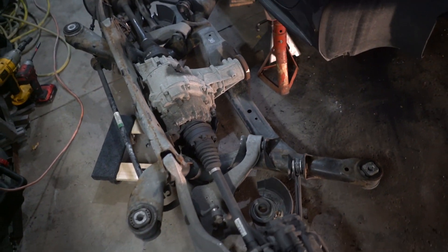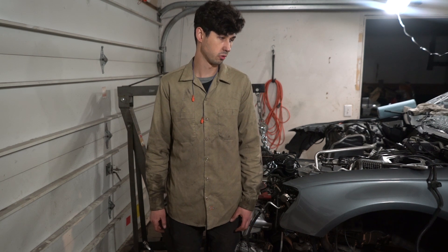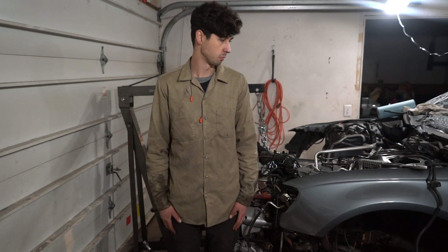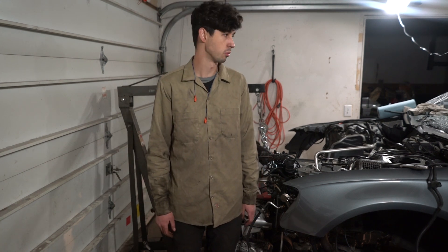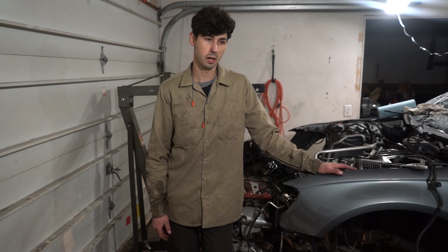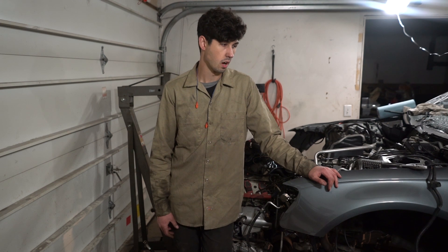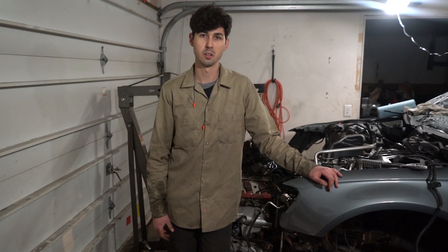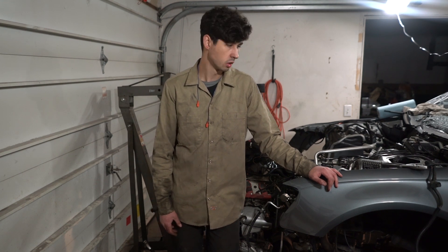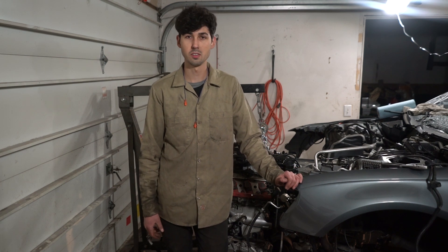As usual with these projects, we've completely run out of space already, so we're moving more stuff into the Avant just to clear out the other bay. That's going to wrap it up for tonight. We got the subframe out — actually pretty easy to do, although it's really heavy. We've got the engine out, seats into the Avant, and most of the interior stripped out of the S4. Next we're going to keep stripping out the final details: the pedal box, the shifter mechanism, and wiring for the sports differential on the rear subframe. Then we'll be working on putting the final interior pieces like door panels and back seats into the Avant to clear space. If you enjoy what we're doing, follow along, give us a thumbs up or subscribe, and share with your friends if you want more Avants in America.